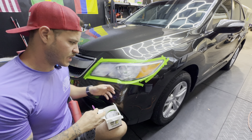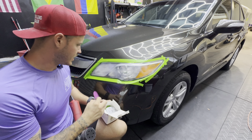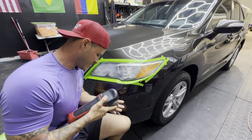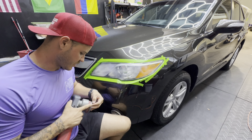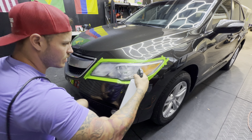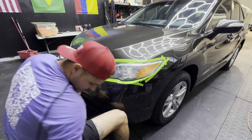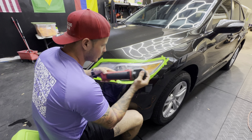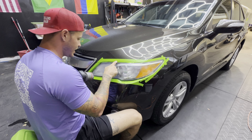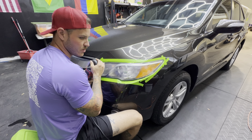Sometimes scratches are too deep and even with wet sanding techniques you're not cutting enough to remove all of them. So as a best practice I'm going to start with 2K. The lowest I've ever gone is around 800 on a really severe case. Go ahead and put your 2K disc on the backing plate, get some water, give a little squirt on the headlight and a squirt on your disc. I'm going with speed four and a half — this is a wet sand, so don't ride the edges, stay as much into the headlight as possible.